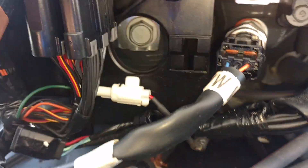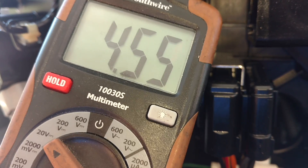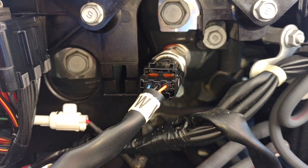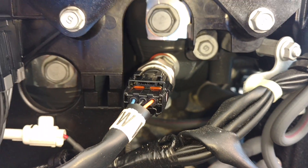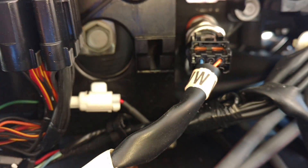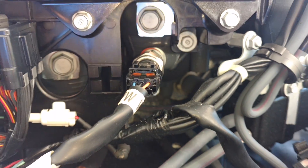Now we are going to check voltage over here at our multimeter, which is just a regular old manual ranging multimeter which you can find in a lot of places, and see what we can find. Often times, when you disconnect the engine harness from a bad sensor or a bad connection, we can get the source voltage to go back up to something in the normal range. So right now we are reading at 4.53. We need to be reading normal Yamaha source voltage which would be very very close to 5.00.